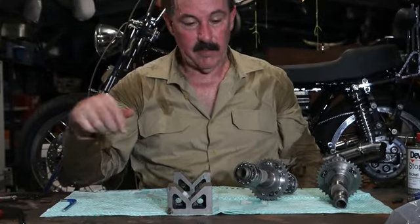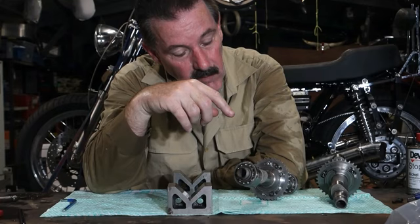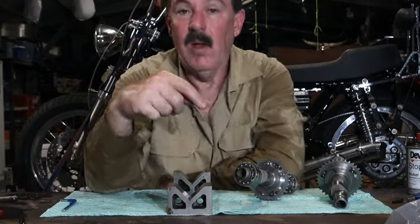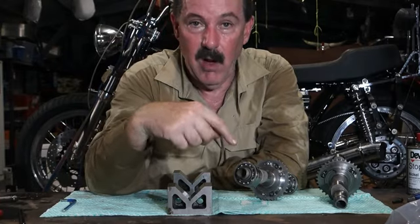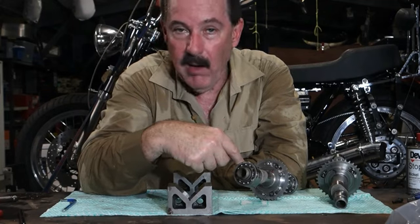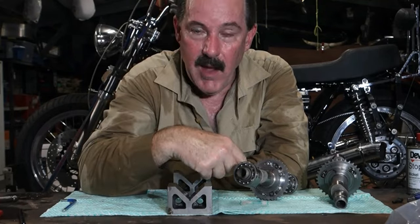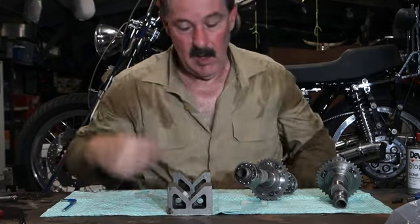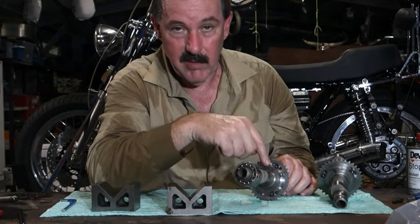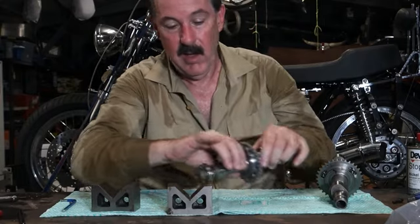When I was doing this, the way I located the holes was to start off with one hole, and we'll call that 0 degrees, and that's the hole that I drilled with the sprocket in place, right, and at the location that I wanted it. So I started off there, and there are 3 holes, so 360 divided by 3 is 120. But I didn't go around 120 degrees. I went 121. Right? 1 degree on the cam is 2 degrees on the crank. So that's where we get our 2 degrees advanced. And then from there, I went around to 242 degrees. So another degree on the cam, another 2 degrees on the crank. And then I came back, drilled the second hole, right, the second one of the first pair, did the same again, 121, 242. So that is my cam, and I'm quite happy with it.